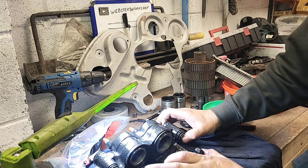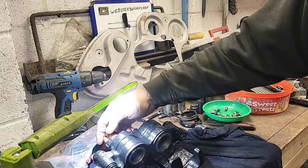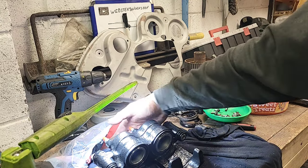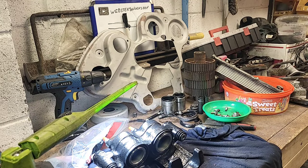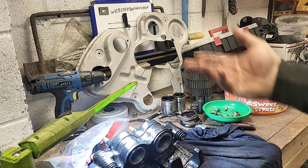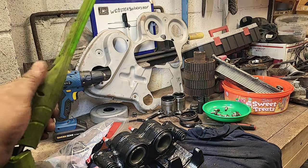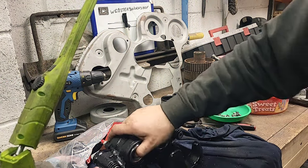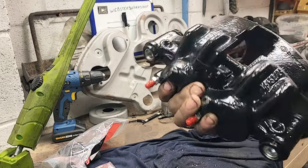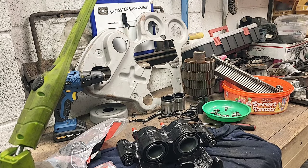The two pistons are nice and free, greased up lovely, good to go — they were literally pushed back in by hand. Brand new bleed nipples on. All that remains now is popping the caliper back on with the pads in and bleeding the brakes. I'm going to wait until I've done the other side, then bleed both sets of front brakes together using the power bleeder to do a cracking job. That caliper is done and ready to fit and it looks a million times better than when I took it off. I think we're going to be losing the light in the next ten or twenty minutes, so let's get on with fitting it.